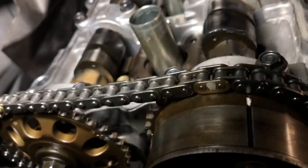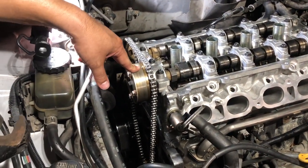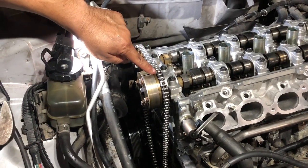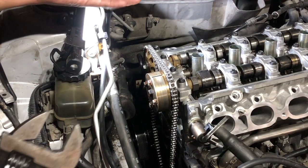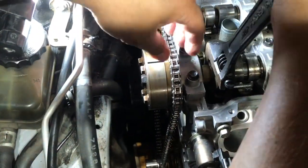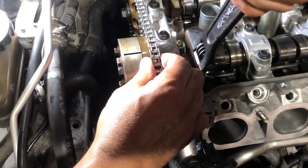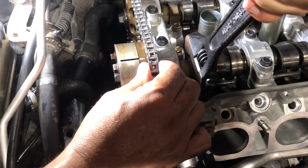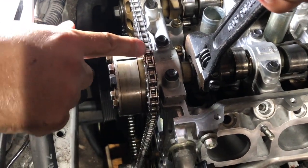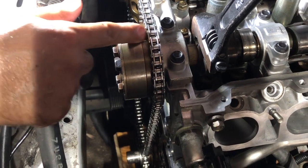I'm going to explain the adjustment of the sprockets for the intake camshaft so we can align it to this gold chain link. The chain link might be orange or gold/brass depending on your chain. What I've noticed — and no one really talks about this — is it's got a spring feel to it. If you let go, it comes right back to its normal position and gets you off the alignment. So what you want to do is align it, place the chain on the sprocket where the gold or orange chain link is aligned to the line on this intake sprocket.